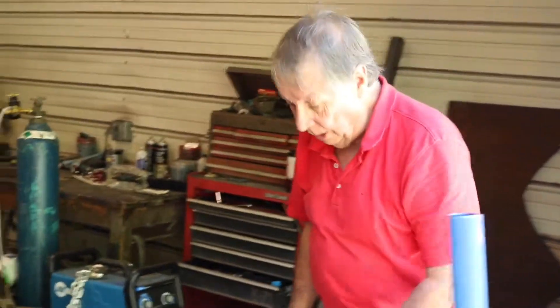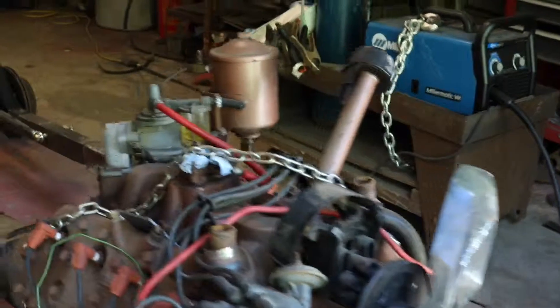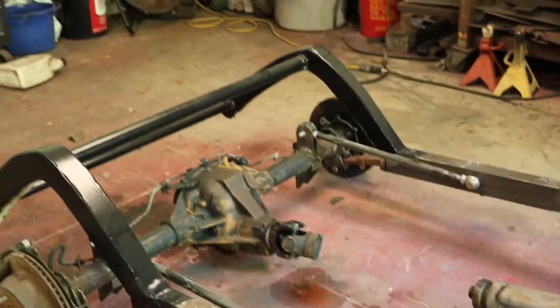Now I've got to wait until I turn the car over to weld the bottoms and the sides, and I'll get that done, but this will hold it now. We're going to gusset it in and when that's done we'll build a transmission mount, and that part will be done. That's some excellent progress, Fred. Thank you — that took almost a day to build because you've got to figure out where it goes, how it bolts up. That's a custom part. Now this is going to be a very short drive shaft, right? Actually that's a long one compared to some — we put some up on sprint cars that are three inches long.